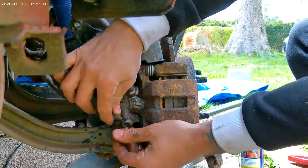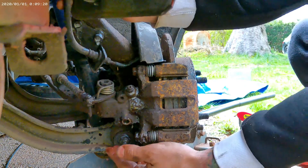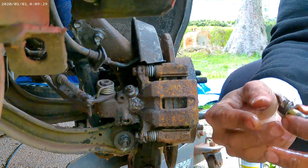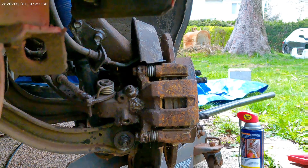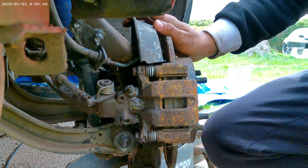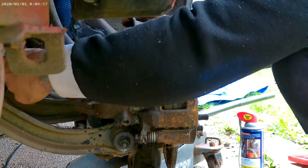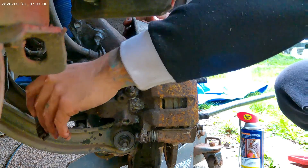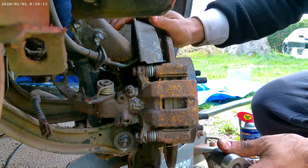Make sure you have a little basin on the floor so you don't leak brake fluid everywhere. There's barely any brake fluid in there because I don't have the master cylinder on. Make sure you keep parts together so you won't have to buy replacements. Please, if you're going to do the job, make sure you do it the right way and use the proper tools. This is the emergency brake wire — you don't have to take that off; the only thing you have to take out is these two bolts, but since I'm taking everything off, I'll loosen everything up.